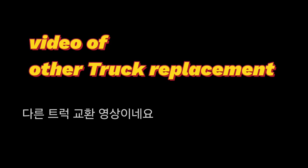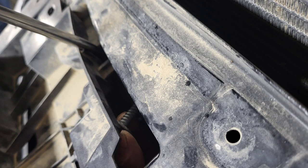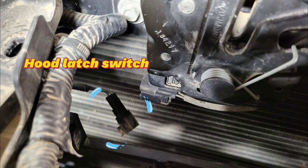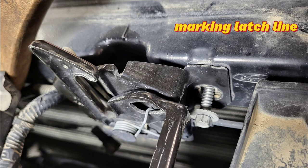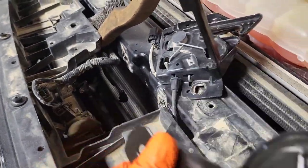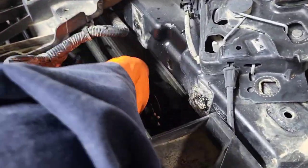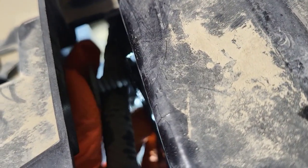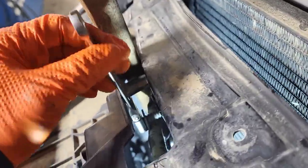I'm showing another way that's much easier. If you have big hands and cannot access the left-hand corner to reach the connector — it's much harder. My hand is pretty small, but if your hand is pretty large and you cannot get your hand deep enough, here's another way. This horn goes through this way — it's much easier. You need to first remove the hood latch assembly to gain access, and then you can reach in this way. It's much easier to attach the mount bolt and even the electrical connector, then tighten the latch. So fast.